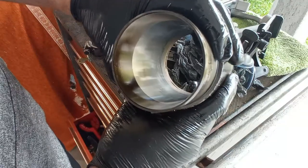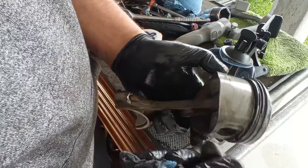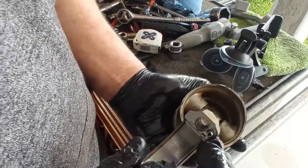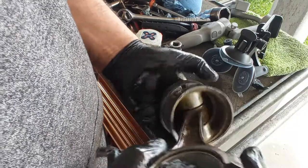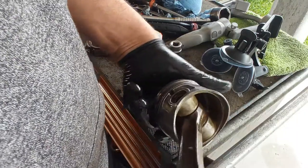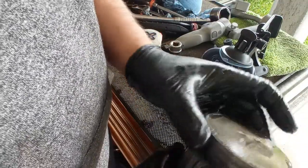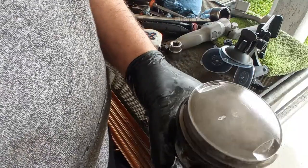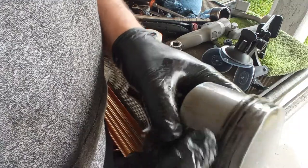Again, here I was trying to figure out the thing with the color of the oil, but now while editing, I was able to think of this theory. But that does not matter. Theory or not, the liners have to be verified for roundness. The pistons too. These piston rings will not go on the final assembly, so the condition of them does not matter. They are used. They cannot be like this.